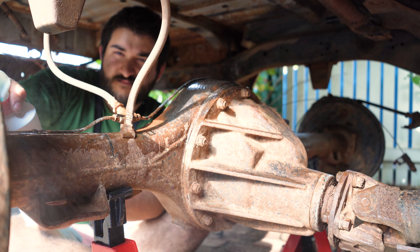All we needed to get rid of was loose flaky stuff. I've gone over it with the wire wheel and sandpaper in all the hard to reach places. I've mixed up the AquaClean at a five to one ratio with water — room temperature water, though it says hot water improves the cleaning potential. I've got gloves that come with the kit and some steel wool, and I'm just going to rub down the whole axle and then hose it off. Every part of this kit can be applied with a paintbrush or a spray bottle, which makes it really easy for DIY especially if you don't have spray guns and a compressor.